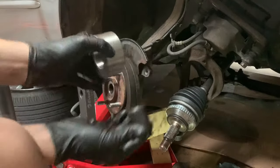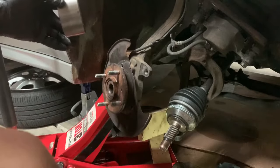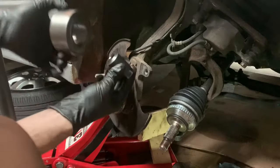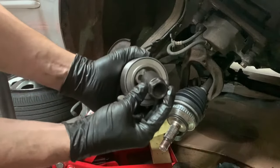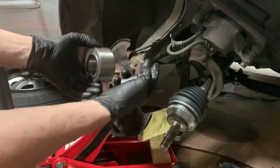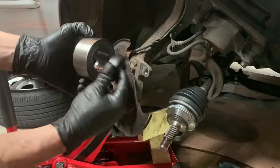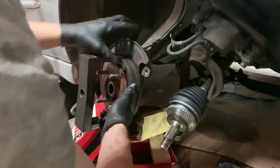It doesn't look like it right now, but the bearing in there has the middle of this spline shaft for the CV axle. So you'll actually just take the nut and it'll go right in there like this and pull it out. It'll take this inner race of the bearing with it as it pulls out, and then we'll have to use a spacer and step washer to pull the rest of it securely.